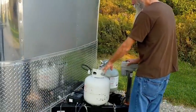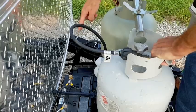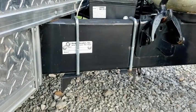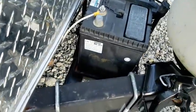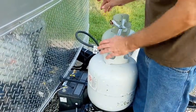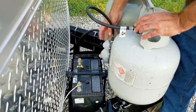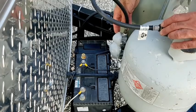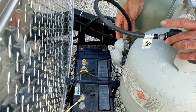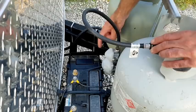We put on the propane pan to hold the two propane bottles. We went with a double battery tray — just angle iron with U-bolts to hold it in place, and the battery trays are from Amazon, so there's room for two batteries. We went with a single bottle regulator — a dual stage regulator made by the same people that make Mr. Buddy heaters. We tried a Camco first but it was dissatisfactory, so we switched and haven't had any problems since.